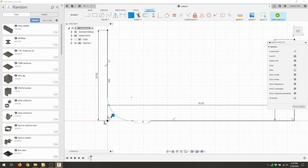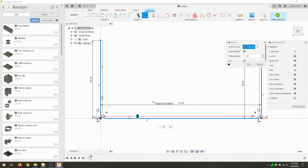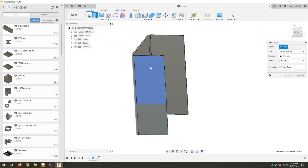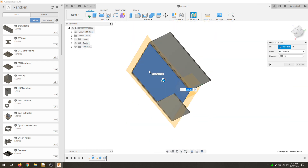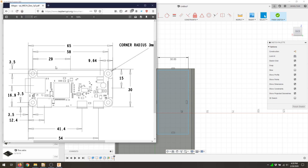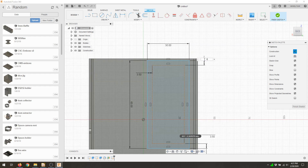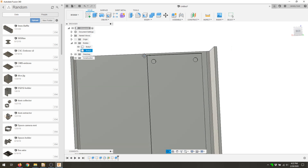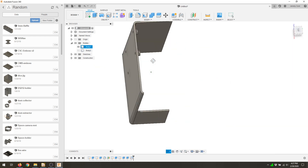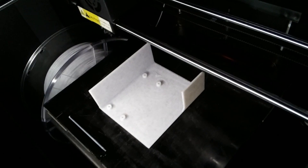It might be possible to stuff the Raspberry Pi Zero W in that chamber for the original electronics and wire everything together in a spaghetti style, as I've certainly done before. But in this case I decided to go ahead and design it carefully with a 3D printed sled type assembly, so I could assemble everything outside of the Keurig, lock it down, make sure everything was just how I wanted it, and then slide it in. I designed everything based on the Raspberry Pi Zero W dimensions — you can see a dummy drawn out there — and I made studs for it to attach to. Since I based this on the actual Pi Zero W drawing, everything should fit up absolutely correctly. Or that was the idea at least.